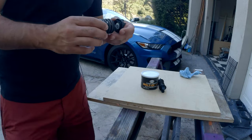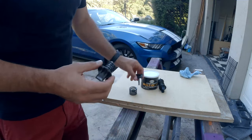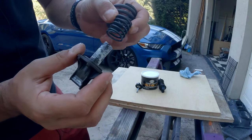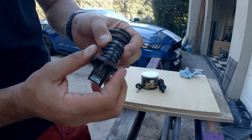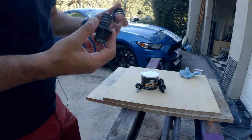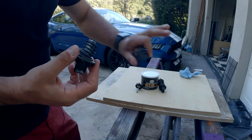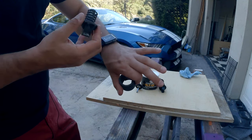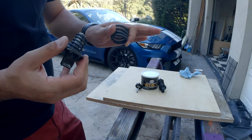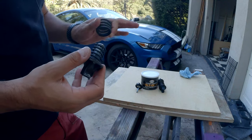You can see it's dirty, but it's a two-stage spring — it's got the small one and the big one. Those combine so that when you have the clutch depressed all the way, it doesn't force your foot back. It's not linear. So like, you have it all the way down and it's not really forcing your foot back, but as you start to let go, it starts to push more and more and it kind of kicks at you. So that makes the engagement of the clutch a little weird.